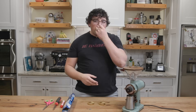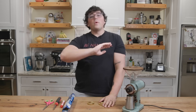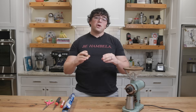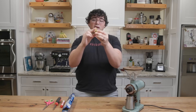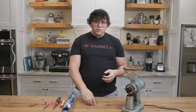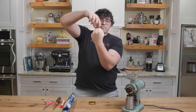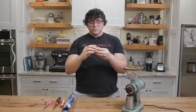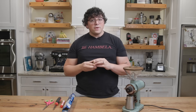But there is a way that you can tighten your alignment. What do I mean by alignment? And first, what do I mean by flat burr? Some of you watching this may not even know that distinguishing bit. When I say flat burr, I mean literally that — a burr set that is flat. If you have like a Baratza Encore, a Sette, or the Niche grinder, those are what are called conical burr grinders — you have a cone burr and a collar that rotates around it. These, however, are flat burrs. I don't really know of a way to align conical burrs, but for flat burrs, I'm going to show you how to do this today.